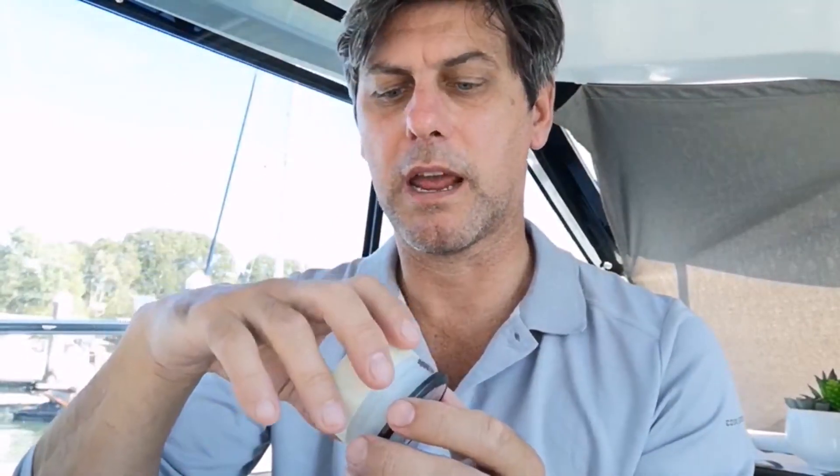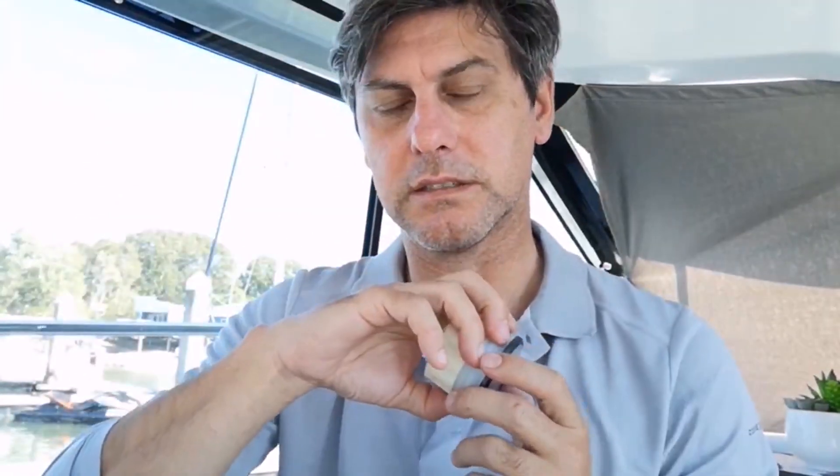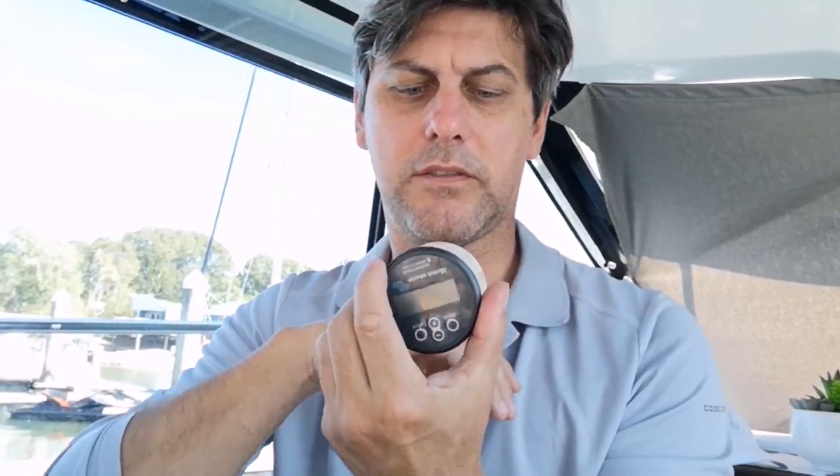This will monitor your house batteries and you keep your starter battery nice and fresh. On the app you can set alarms - if your voltage on the second battery starts dropping because you've forgotten to turn something off, it will alert you. You can set alarms for when you reach certain voltage or certain amp power usage. This is especially good if you've got AGM batteries that you can't drain past 50% without damaging them.